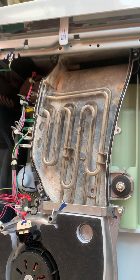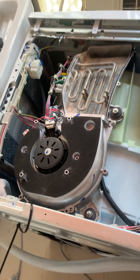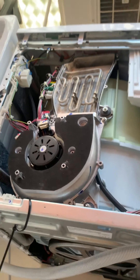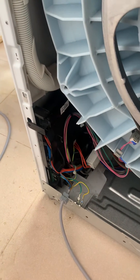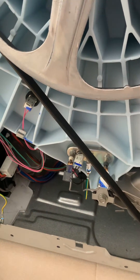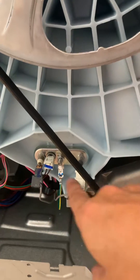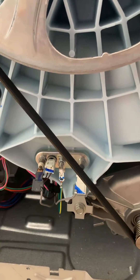As I said, with anything electrical be very careful — make sure it's unplugged when you're working on it. Don't run things without a ground; that was purely for testing to confirm an earth fault, which obviously it was, otherwise it wouldn't have tripped the RCD. The other common culprit is the bottom heater element, but that one seems to be okay. And that's it.